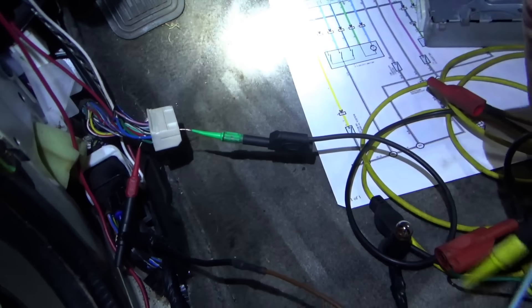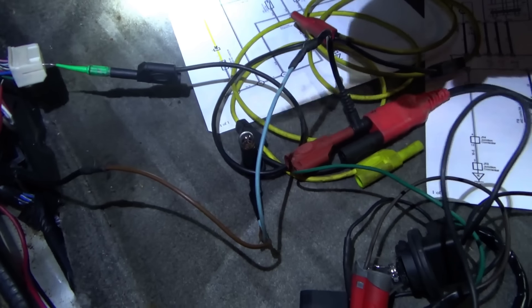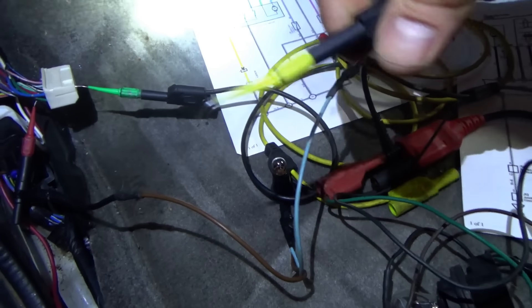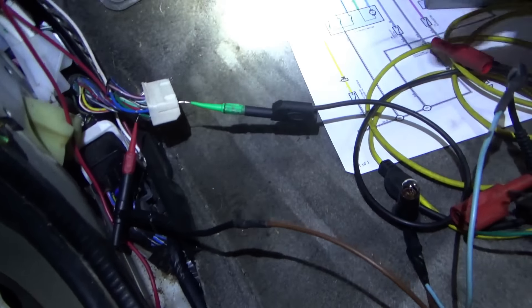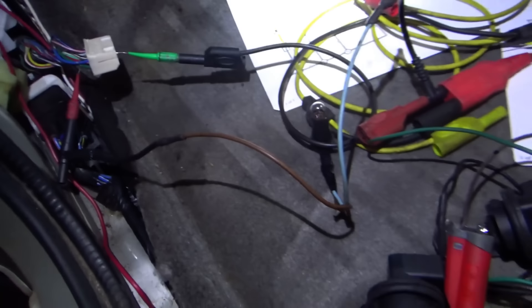Through a 4-amp test light - actually let me put it in the other bulb; we'll have 4 amps on this wire on this needle probe. It's a safe way to do it - we're not putting power directly to the motor, we're just putting 4 amps. So let me put in the extra bulb and we'll try to drive this motor.